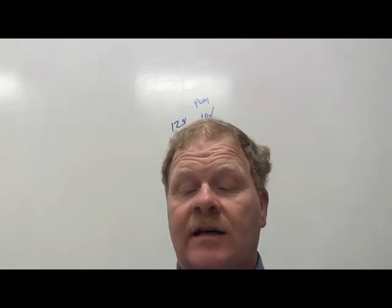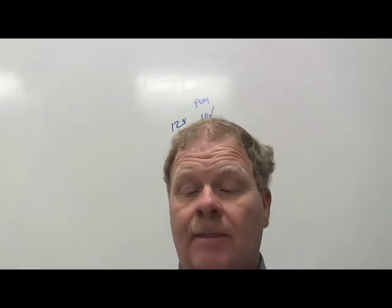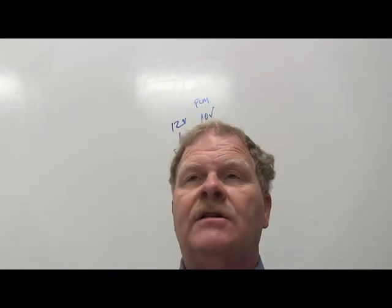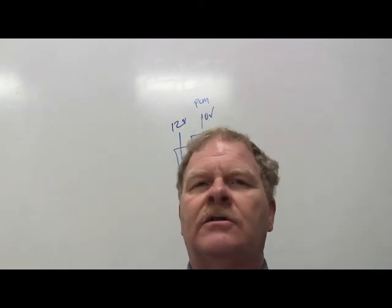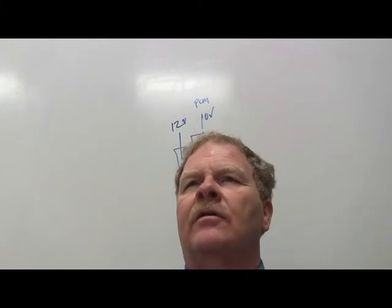Which of these describes acceptable oxygen sensor cross counts? 8 to 10. That's going to be B, 8 to 10 at 2,000 RPM. And guys, there are some sheets in Engine Performance that talk about fuel trim and oxygen sensors and all this. You need to get used to those and work your way through there.